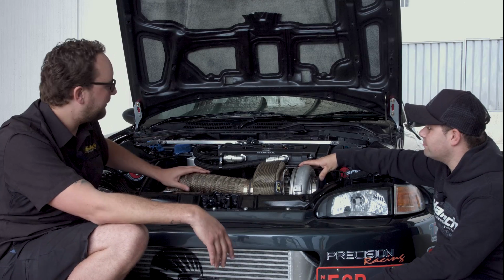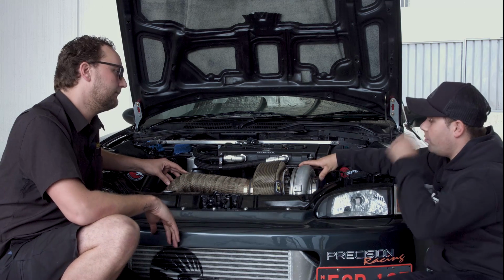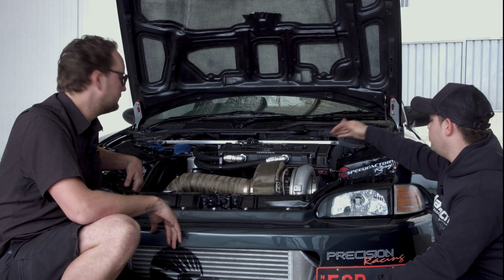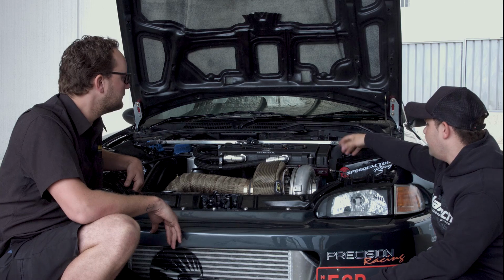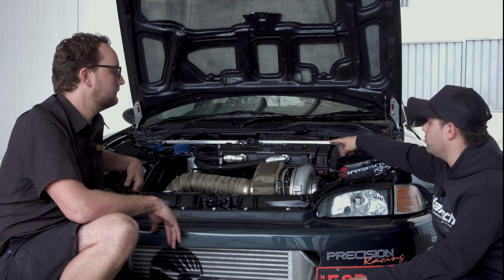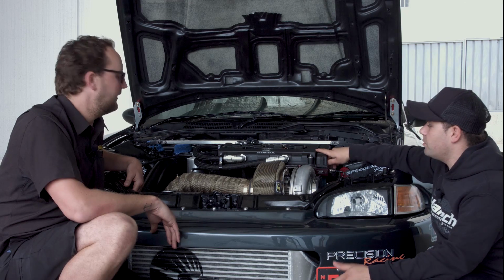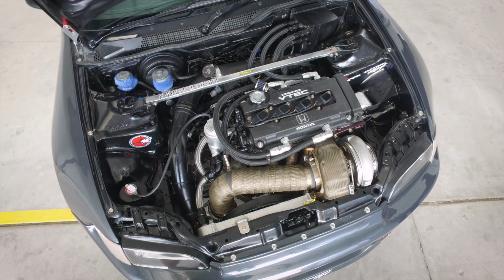And this dump pipe, how big is it and where does it go down here? Okay, so it's a 4-inch dump pipe straight off the back of the turbocharger. It goes underneath the car to a 4-inch flap valve over here. Basically, it's like a wastegate. As soon as it sees positive pressure in the manifold, it will open and dump exhaust gases out. And so it awakens the giant. Definitely, we don't want too much back pressure in there.